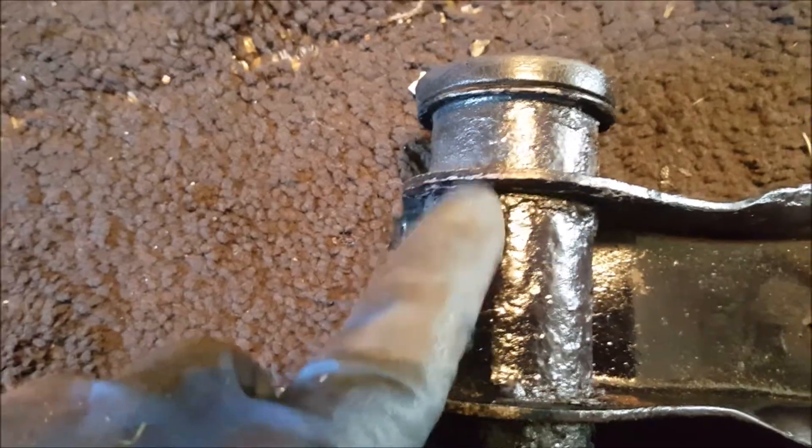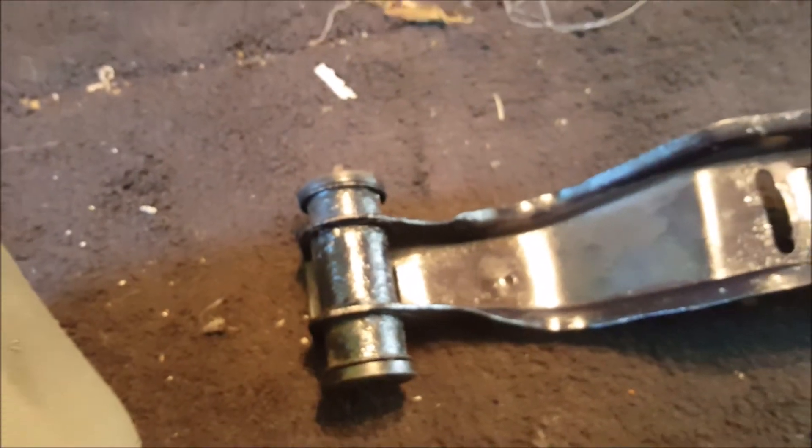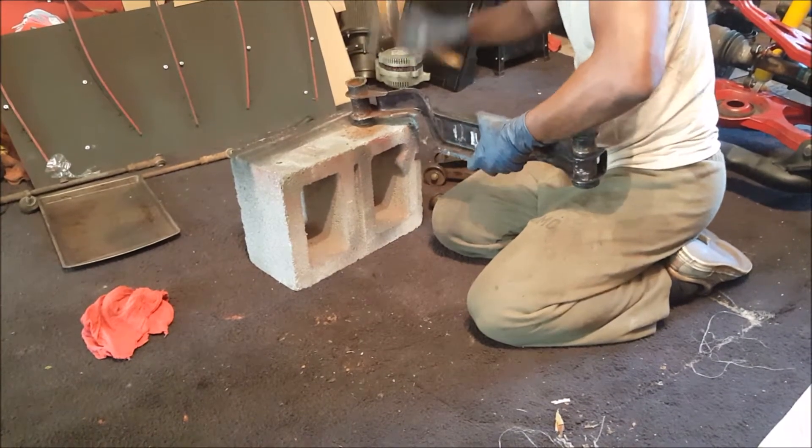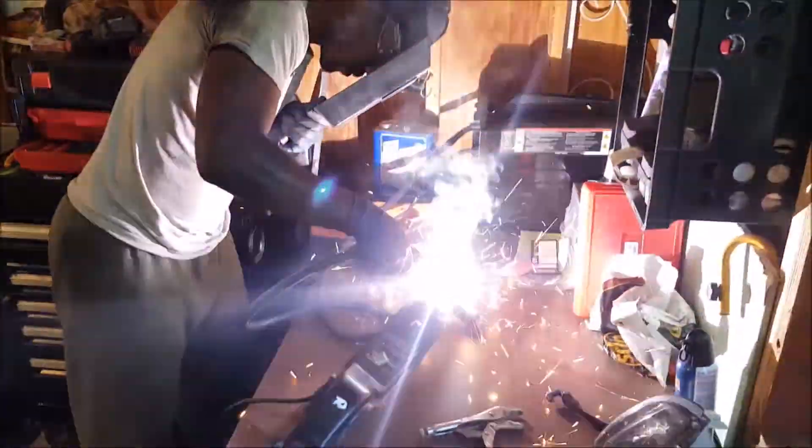We just hit a little snag. When we tried to bolt the transmission cross member in, it was sitting too far forwards and the bolts wouldn't line up. What you have to do is look for the little spot welds in here, grind those spot welds off, and this whole tube will actually slide backwards and forwards. So you cut these four spot welds off, slide the tube back, then re-tack weld them in place and everything should sit the way it should. The stock cross member tube just slides back a little bit further, and that's it.